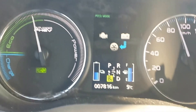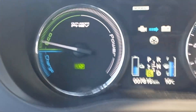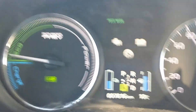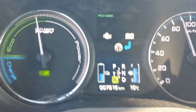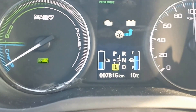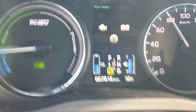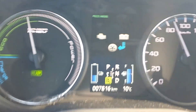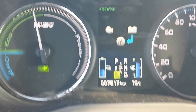Let's see — I keep full throttle and now I switch to normal mode, and we have the gasoline engine. If I switch back to eco mode, we won't have it except if I press kick-down. So now it's full throttle — now kick-down. Also, the gasoline engine will start if speed is over 130 km/h, so up to 130 you can go on electrical power, but over 130 the gasoline engine starts.